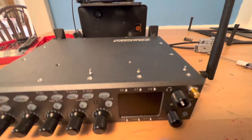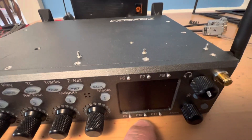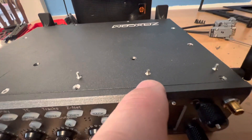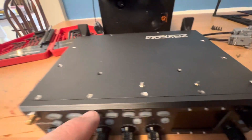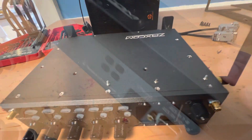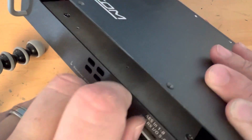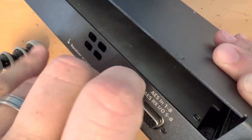It's worth noting that the screws that live over this F7 key and on the underside here, F10, are a little shorter than all these other little screws. So when you put them back, make sure you put the short ones here and here. And if you have a Nova 2, these two screws have to come off of this DB15 as well.